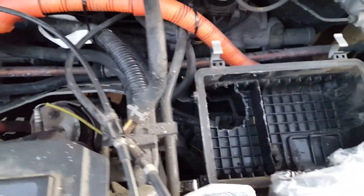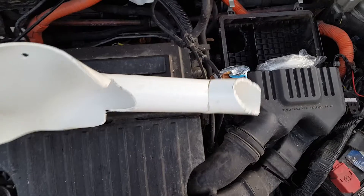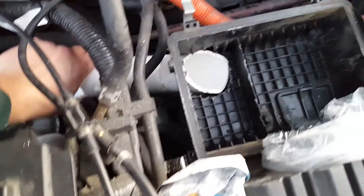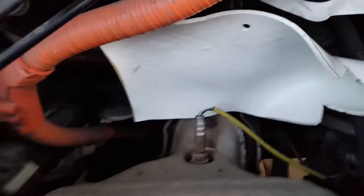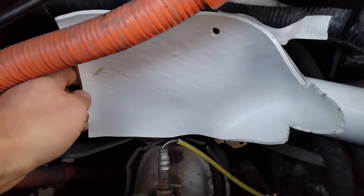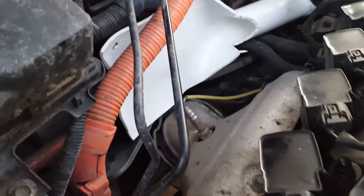I cut a hole back there. I thought the best way to get some warm air to come in here was to get a shield right off the exhaust manifold. So this homemade contraption fits in here, kind of wedges in, about like this. And then the plan is, since that's sitting on the manifold, I punched a couple holes and I'll just zip tie it up here to keep it out of direct contact, and see if this way I can draw some of that warm air up in.